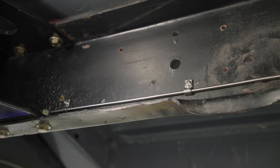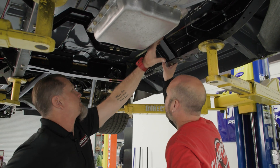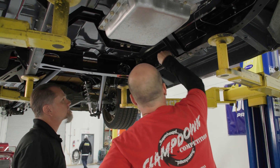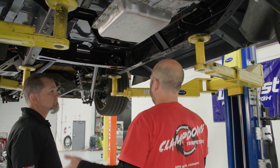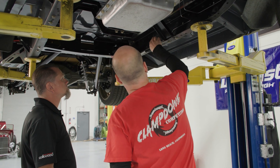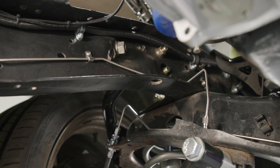I really like how you kept everything off onto the frame rail. Right, because we're going to have exhaust coming through here. I always like to try to tuck it in if I can. You don't want to put it on the outside — you just want to think about what could come up underneath the truck to hit it and damage it. So I try to tuck it in, and really it starts to dictate itself where it wants to be.